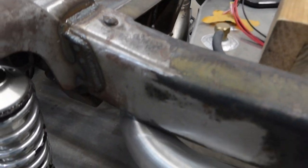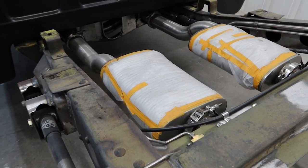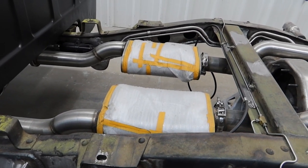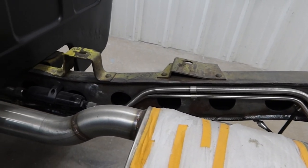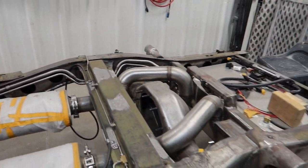What's really unique about this truck is the exhaust routing too — up and over the axle, around the tank. It's packaged very, very nicely. Those are Hooker VR304 mufflers, what we've been using on pretty much everything recently. All stainless hard line fuel lines. And of course, the frame is boxed in as well, just for a little bit of rigidity.